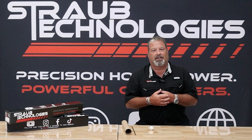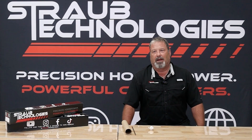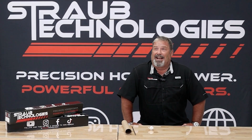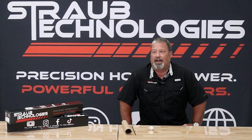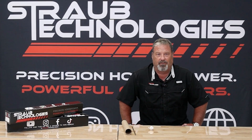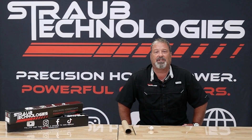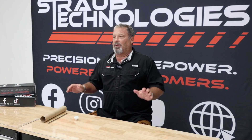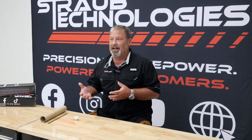I see on Facebook groups, I see on forums — I just had one the other day, a guy calling me up building a 427, I think it's a 1970 El Camino. 427, 60 over, and he's bought a set of aftermarket heads that are 335 cc's. This thing's not going to see over 6,000 RPM. I told him it will be a slug, it will not run. Silence over the phone. Somebody else had told him that too — because volume doesn't fill that cylinder, and we're dealing with a short stroke big block Chevrolet, so it doesn't need that much cross-sectional area.